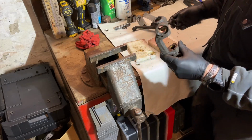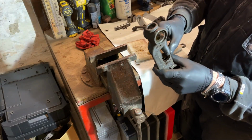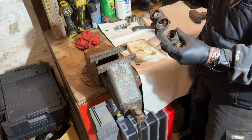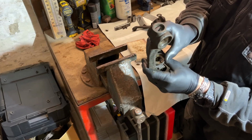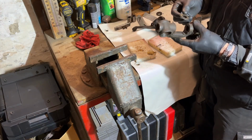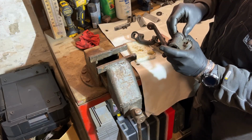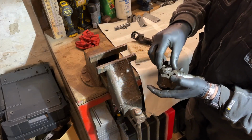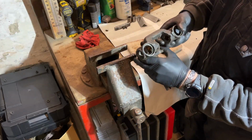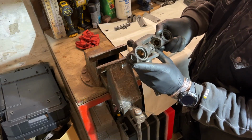So why you always have trouble to get it out, because there are 2 little knobs there, that sits here, so it cannot turn. A little plastic ring, and that has to slide to come out in the same direction. And underneath it, we have a pin that is sitting here. This washer, you see, and this goes up on top, and that has to slide in this piece. There's only one way because this is not possible, so it has to go in like this.